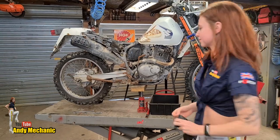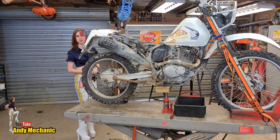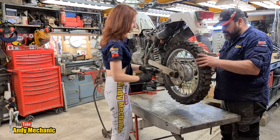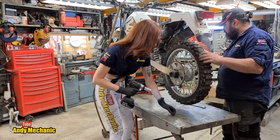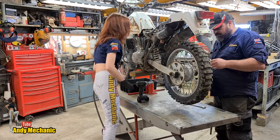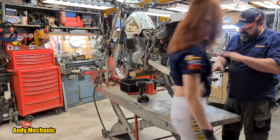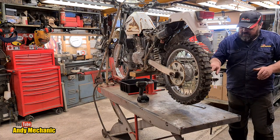I've got some tools out ready for speed. If you head over to the back of the bike you'll find the impact wrench — hopefully it's got the right socket on it. Main spindle nut first. Now put a box down, you can chuck all the bits in the box. Come around this side — we've got the brake rod and stock to take apart as well. There's a 14mm nut there and the wing nut to come out as well.